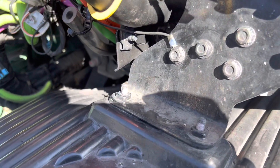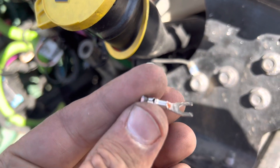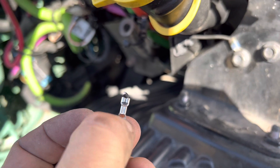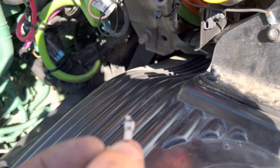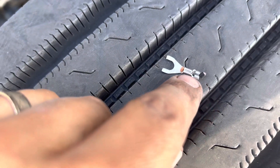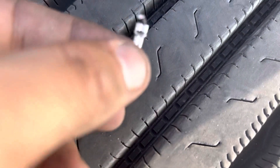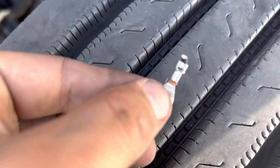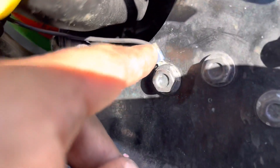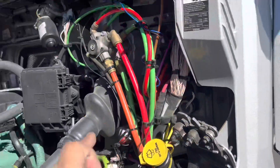If your blades don't work, my problem was figuring out this connection right here — it came over-tight, and those wires didn't actually make a proper connection. Because it was over-tight, it wasn't bringing power through. That's why it failed on both sides. If you have that problem and the blade doesn't work, cut this connector and get a new one, plug it in right here. For the ground, you can choose left or right, but I put it all on one side for a cleaner look.